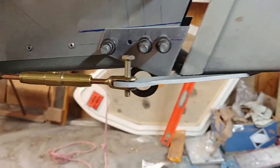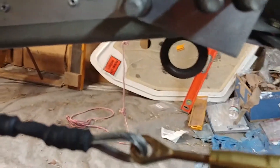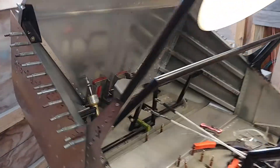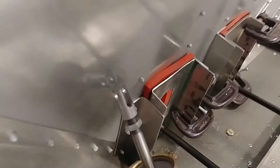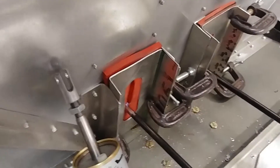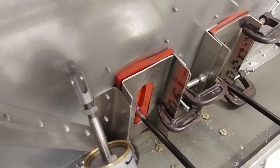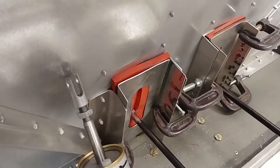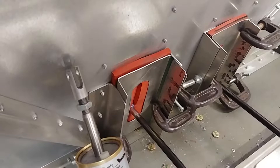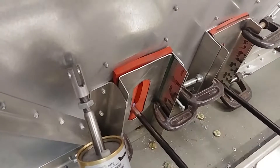I think I got my final solution. I left my rudder stops where I get full 23 degrees deflection — I was going to move them. But I came up with a solution for the sliders and the firewall. I made these brackets on the inside with quarter-inch high-temperature rubber — it's like 600-degree rubber — quarter-inch thick, with slots cut in them for the rods to fit in, and those brackets there.